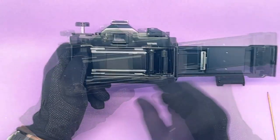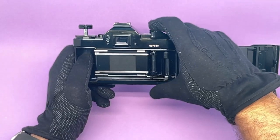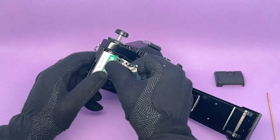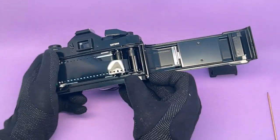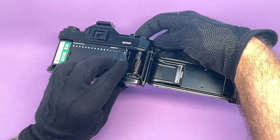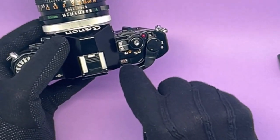To open the back, open the film rewind, pull it out, and pop it further — the back opens. It's a cloth shutter, so it's not as advanced as some later cameras with metal vertical shutters, but it operates horizontally and has a very reassuring, solid feel and great sound. You load film like any 70s or 80s SLR — stretch the film across, put it into one of the many sprocket holes in the take-up spool, advance a little while engaging with the sprocket wheel, then close the back. Advance a couple of times until it reaches the orange mark.